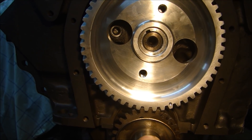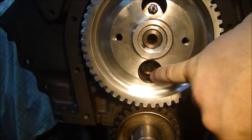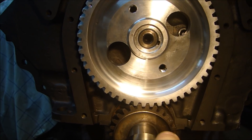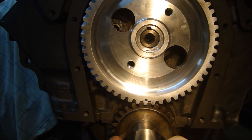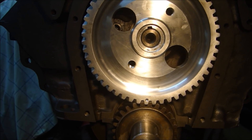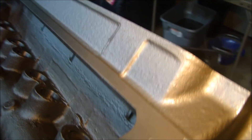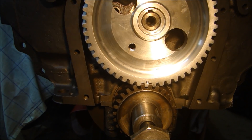When you turn the crank, you'll get access to both bolts in the camshaft thrust plate, and you crank and torque those down. Then when you turn the engine over and get this timing mark all the way back to right in the middle — piston number one is at top dead center. I put two lifters in here — both of the lifters are all the way down, which means I've got my crankshaft lined up correctly with the timing marks.